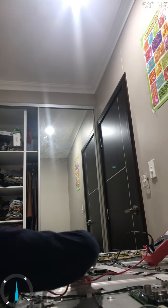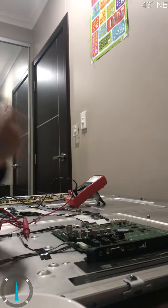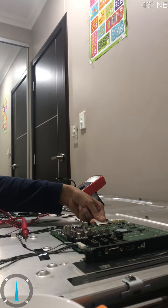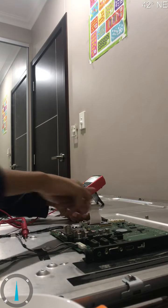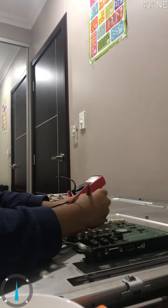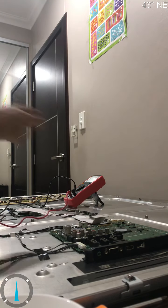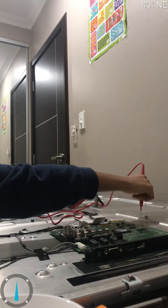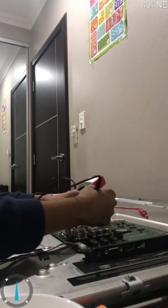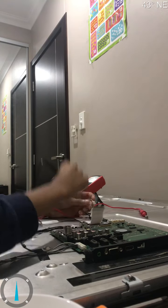It could be this cord, but this cord is actually good because look, it's working. If you pull it out, you don't need to pull the top connector — you need to pull the original wire itself, just like that. Make sure you note that slip, then get your multimeter. Put your negative lead and your positive lead — make sure they're working. Put your positive lead right on a bare metal surface, like a screw. It does have voltage — 42 volts. That's a quick tip you can use just by checking the voltage.